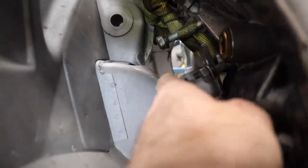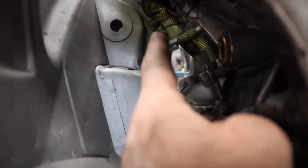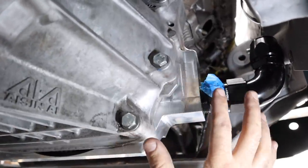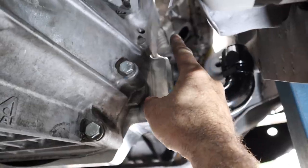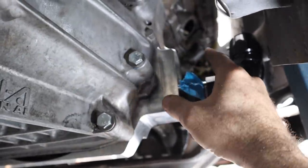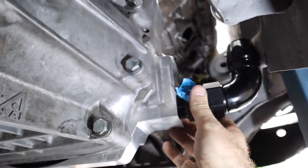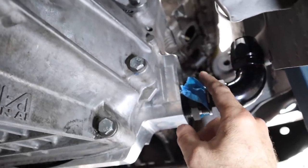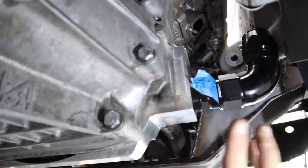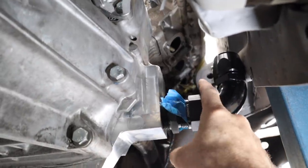This is the driver's side, and this is the side where we're going to have lots more issues. In here we've got to fit an engine mount and an exhaust manifold up here somewhere, going all the way back. Down underneath the car looking back the other way, you can see the exhaust ports on the engine. On this side, I've got to fit an exhaust manifold as well as the engine mounts, as well as this massive Raceworks AN fitting coming out of the adapter plate — that's for the dry sump return from the oil tank, which I'm going to have to make up as well. And somewhere in here I've also got to fit steering. So there's a lot to think about.